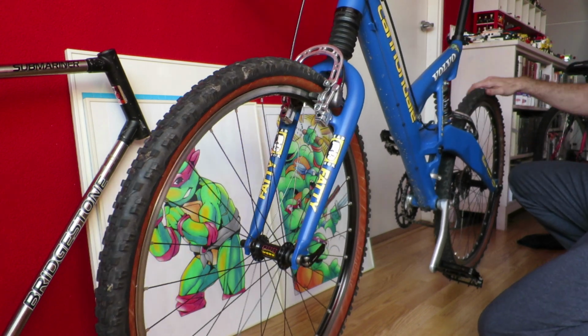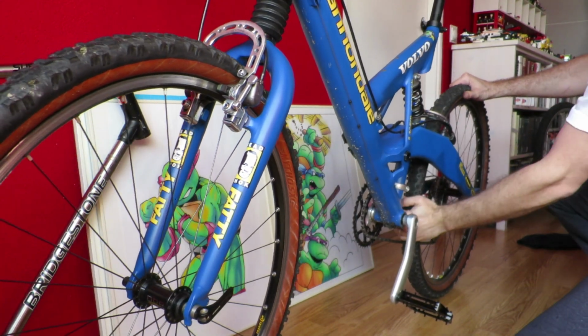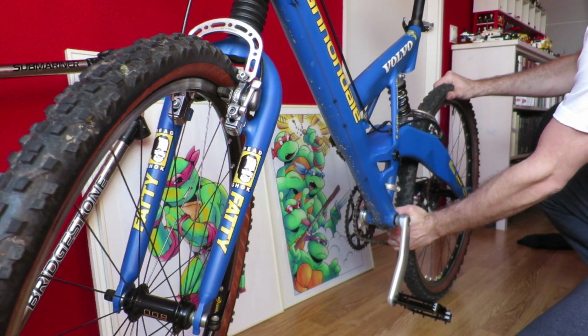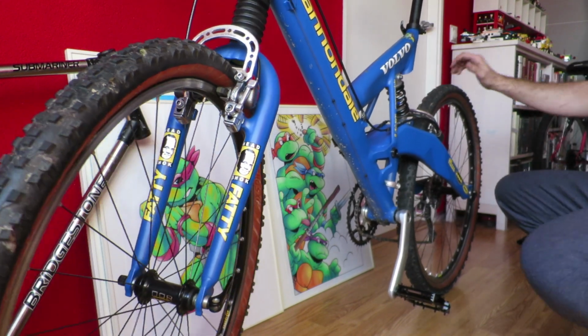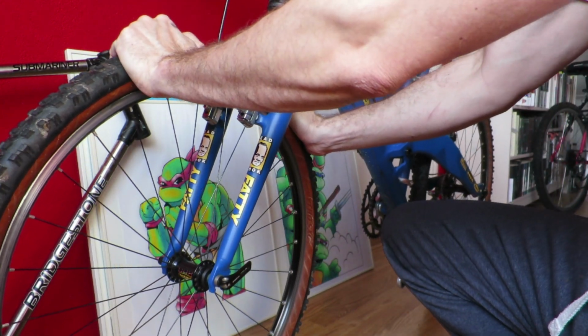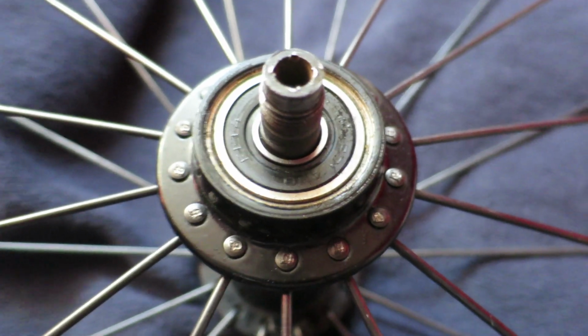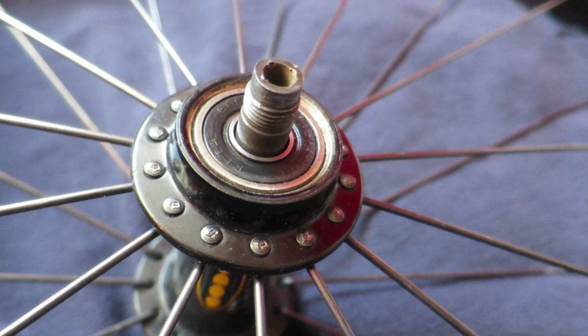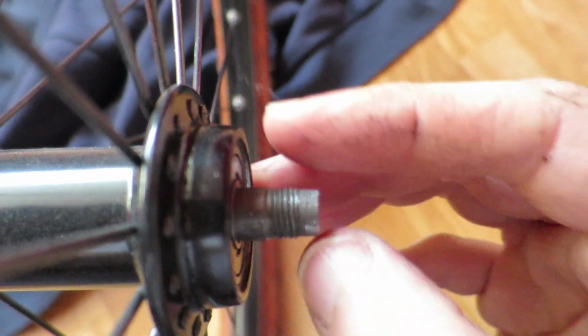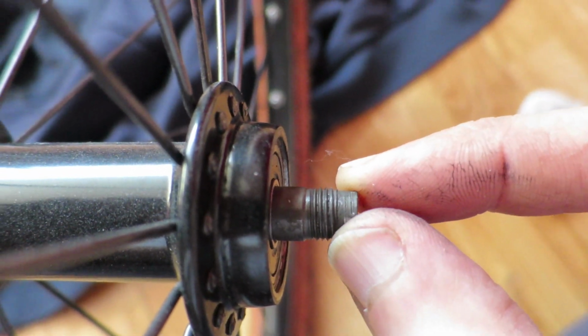So I noticed a significant amount of play in the rear wheel of my Cannondale Super V. I'm not unfamiliar with play in either the front or rear wheel. Many bike restorations include removing the play from a bicycle wheel. The wheels from this bicycle, however, don't have a cup and cone style hub but sealed cartridge bearings, which are much less prone to show side-to-side play.